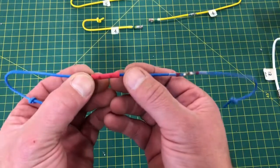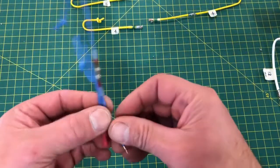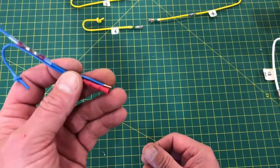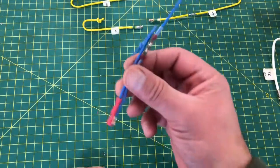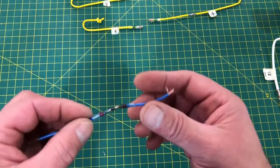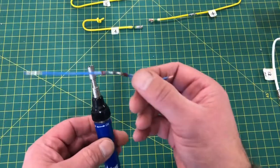Here's the butt crimp, you know, just the solderless connector. Yeah, utter failure. I mean, only use these in an emergency and fix it later if it's got to last, because it won't. They pull 2 pounds of force, maybe. It pulled right out.